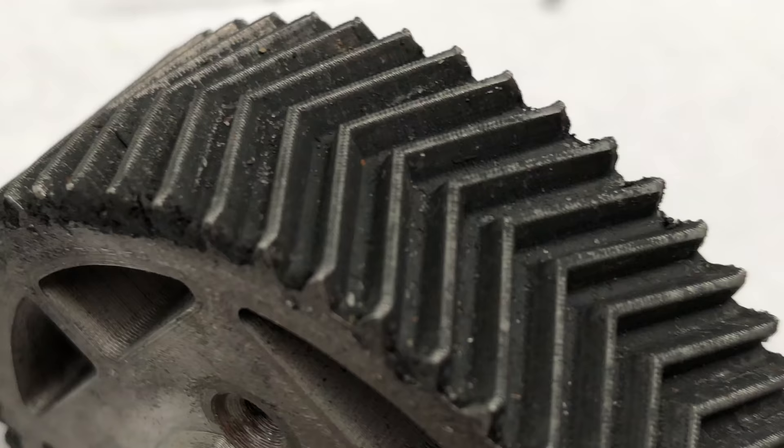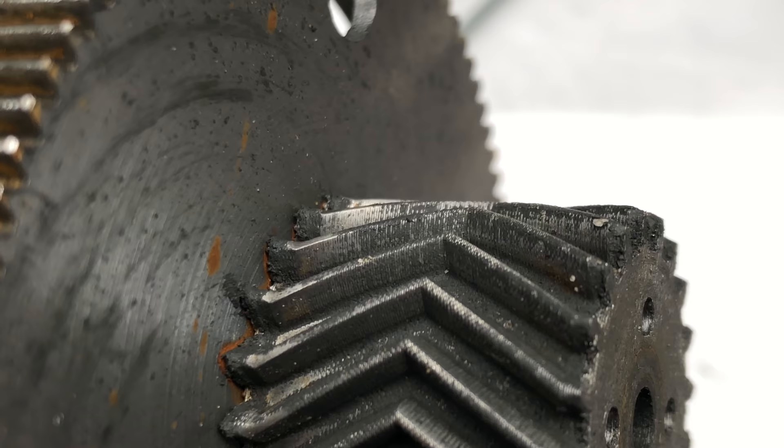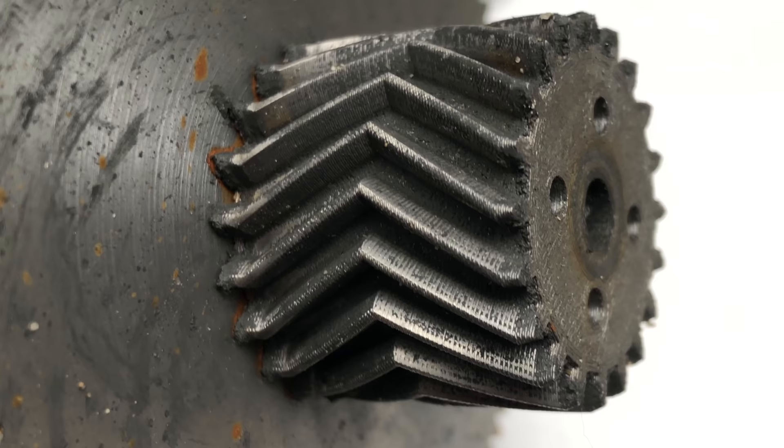After quite a few hours of driving, the metal gears showed a tiny bit of sign of wear, which is kind of surprising — I would have thought they'd show almost no signs of wear. But towards the insides you can see how the little 3D printed FDM ridges were kind of smoothed out just from contact with the other gear. That could have been primarily from sand getting stuck in there and sand-blasting everything down smooth. So just out of curiosity, I installed a new flat-tooth 3D printed gear set.